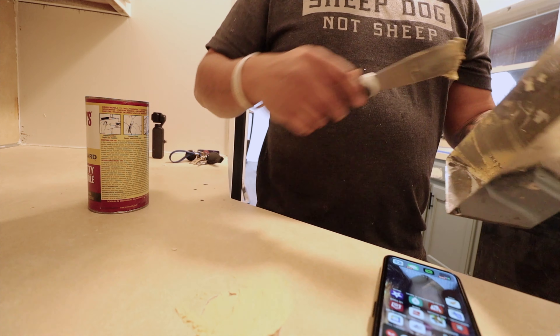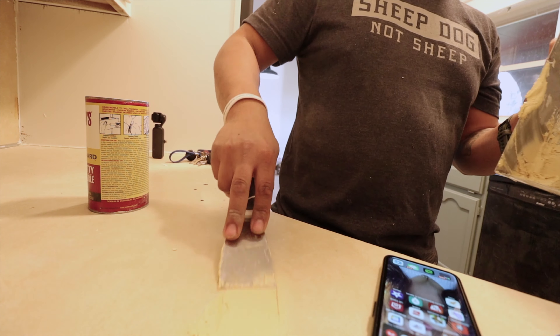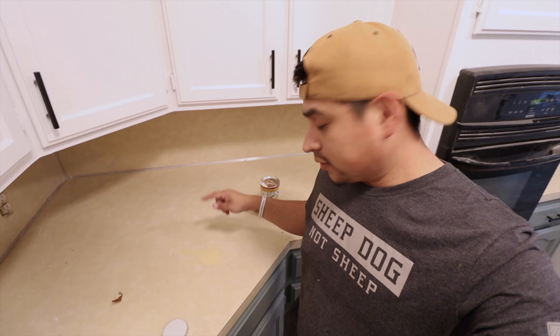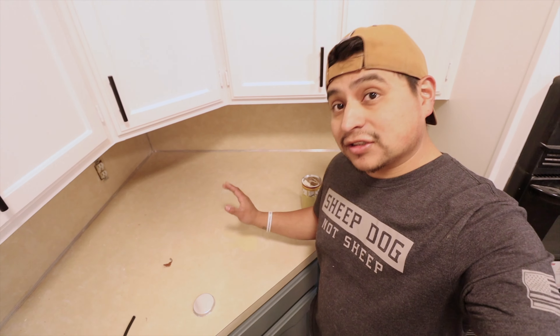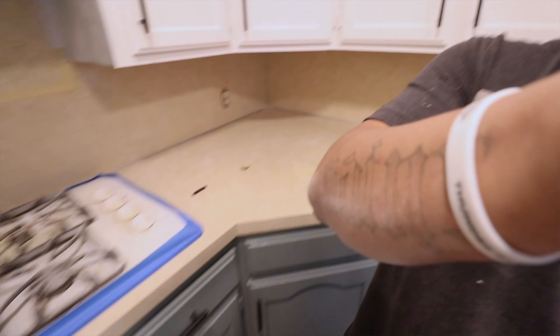Then we just put it with the spatula on our repair — went a little bit bigger than the actual size of the repair. The main thing is trying to get it as smooth as possible so that the sanding is minimal. Alright guys, we got it repaired. You can see the area right here — kind of blends in but already looks a lot better. We're gonna let it dry; this stuff dries really fast, you don't have that much time to work it, maybe five minutes and then it's gone. So we're gonna let this dry and then we'll come back and paint it.